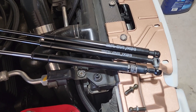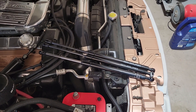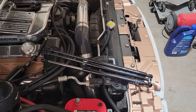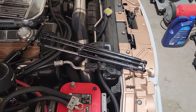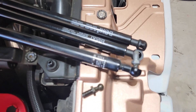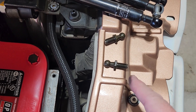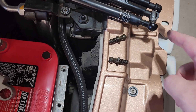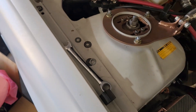This is actually a really good replacement strut — it should keep the hood at the same height as the OEM ones. I've seen people using other universal-style struts and they extend the hood more, so if you like your hood higher that's fine, but if you want to keep it at the OEM position with the correct pressure, the Santa Fe ones are perfect. The OEM ones have the ball attached, and the top bolt also had two nylon washers — keep those for reinstallation.